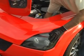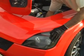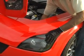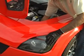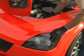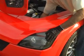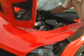Now, what is very important is that you don't want to drop the nut or the washer when you're removing this. So, loosen it, and when it feels quite easy, remove your socket and do the rest by hand. Remember to keep a tight grip of the nut, because you really don't want to drop this. So, there's the nut. Put that on the radiator. The next thing to come out will be the washer. If you pull the clamp off, you will drop the washer, or you may drop the washer, you're on risk. So try and get the washer off first. There's the washer, the penny washer.